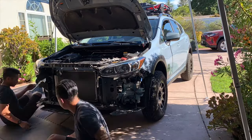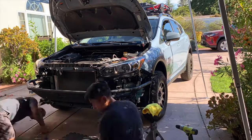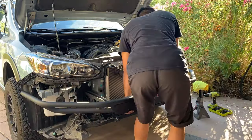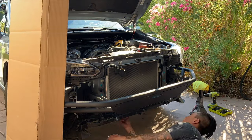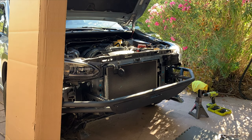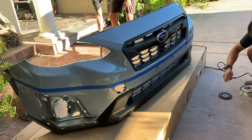Basically the gist of it: you're going to want to remove the front cross members. Before that, you've got to remove the plastic bumper and get rid of all the trim. It's a really easy install. We did need to get some wider washers — the ones supplied were really skinny and the factory mounting holes aren't the biggest, so we put bigger washers on them, double stacked, which helps a lot with fitment. We took off all the plastic trim, the inner styrofoam bits, and then the front cross member.